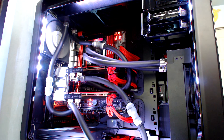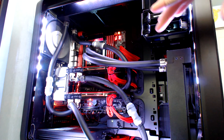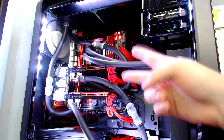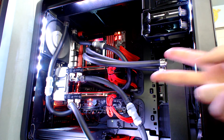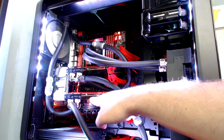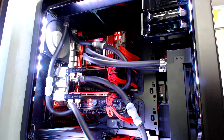I actually turned the fan speed down from the default due to the PWM connections. So now we're going to get to the Predator 360 and exactly how I configured it to work as an independent loop for the full cover water blocks from EVGA. These are the Titan X acetal copper base water blocks — you can see the copper there instead of the nickel plating — and it also has really nice back plates. All of the water cooling stuff here was from EK.